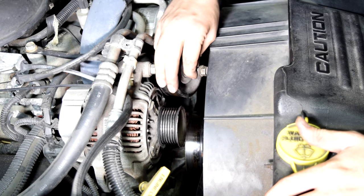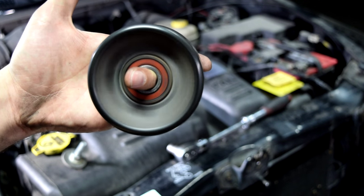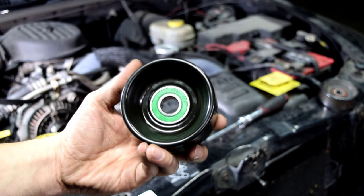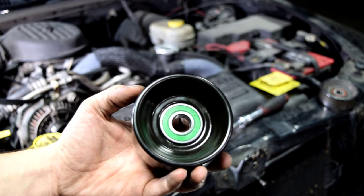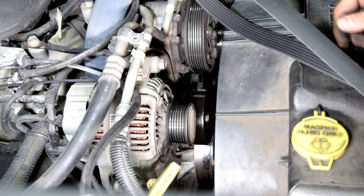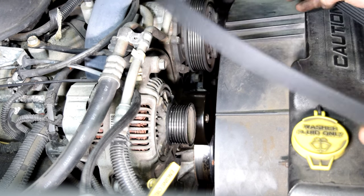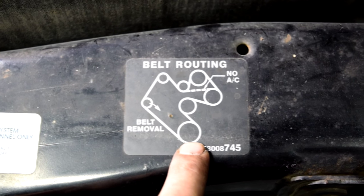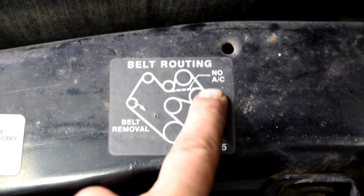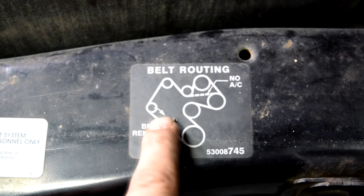Make sure you don't drop any washers while taking this out. And here's how a bad bearing sounds like. $25 later, here's a look at our new idler with our new bearing — we're just going to go ahead and throw this back in. Next it's time to put our belt on, and it's a very good idea to mark which direction the belt is turning when you take it off, especially if you're going to reuse it — you need to put it on in the same direction. The easiest way to put this on is to start at the bottom where your harmonic balancer is, then go around all the pulleys counterclockwise, and your tensioning roller is going to be the last pulley you put the belt over.